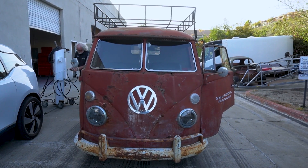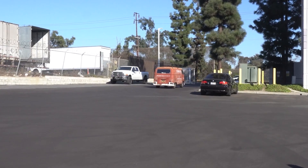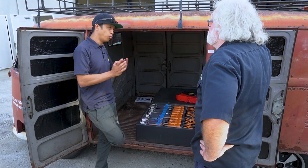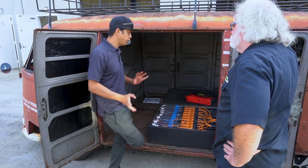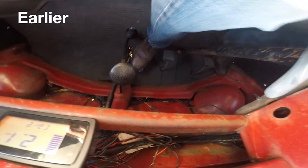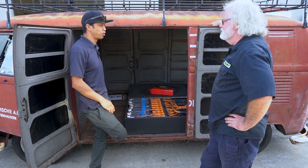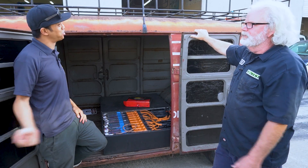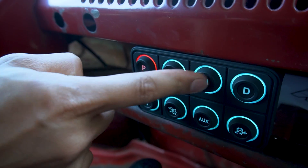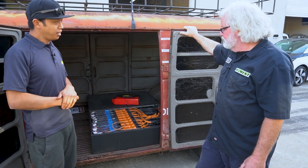You guys made a lot of improvements on our little bus. Some of the features we added: hill hold, and one of the things Kirk talked about when he first got his driving impression was pedal bounce. I've got currently four different performance modes — most of it is just throttle response. Level one is the softest level and performance level four is super responsive. We've done a lot of filtering with the torque control and the pedal control, especially with this bus with the suspension back there — it's hard to maintain a good throttle input. So it dampens that out pretty well. And when J1772 is plugged in, it disables any torque — it won't let you drive away plugged into your wall.